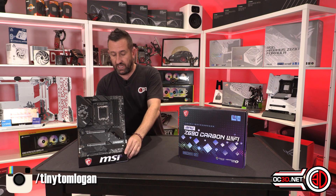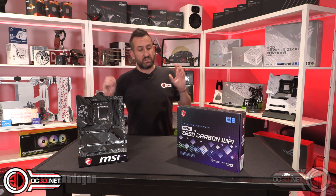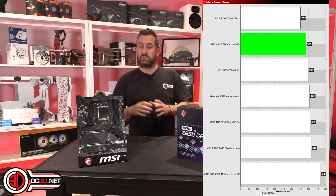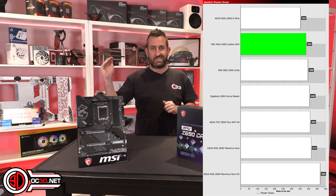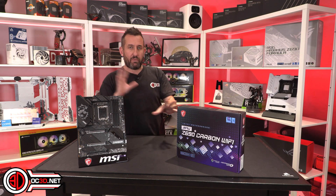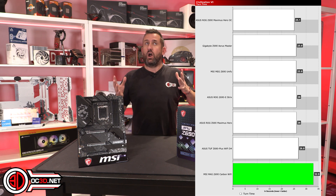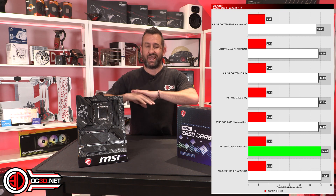I've whittled through this quite quickly mainly because time has been of the essence. The first thing I'll bring up is power usage - it being low could be seen as good, but it also rings alarm bells for me because it normally indicates lower performance. In our stock tests, if a board lets the CPU use more power it can hold boost consistently longer, meaning higher average clock speeds and better average performance. The Carbon has been in the lower part of the graphs throughout testing. I also found some instabilities at certain points when using Sandra, and it got a bit shaky.